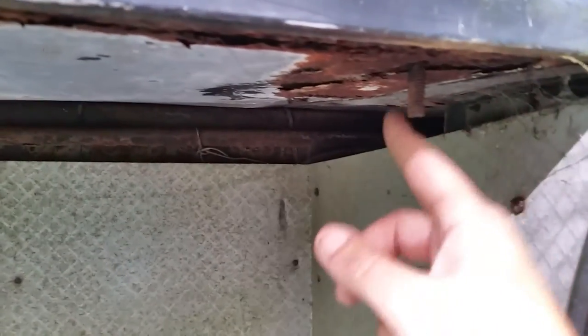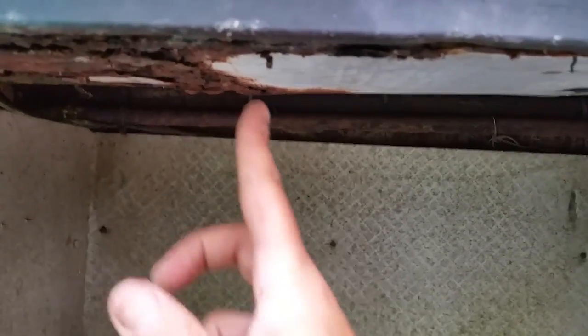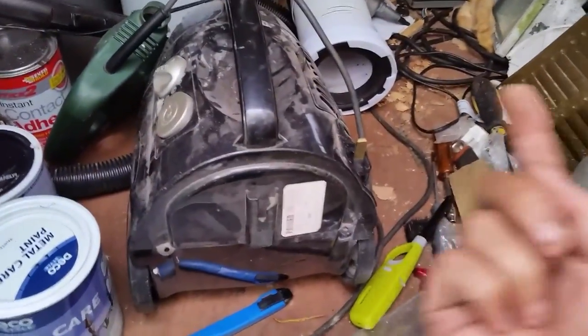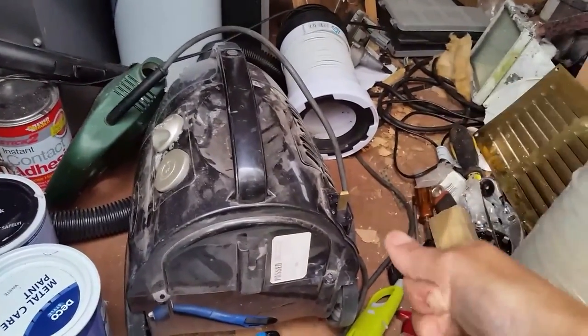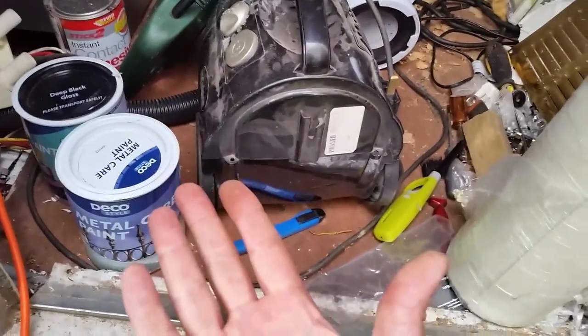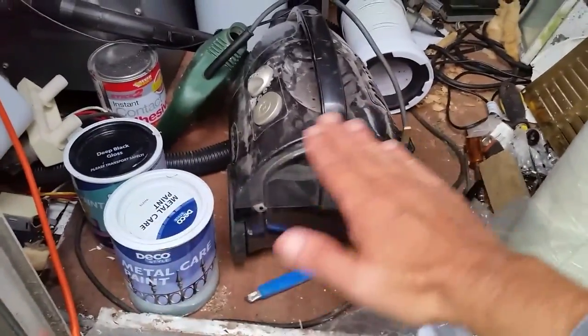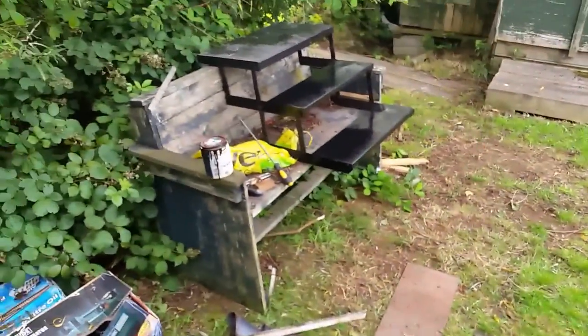So I've got the other three points — there's this one, another one there, another one over here, another one here. I'll need to re-drill those through the floor on those three points, and then cut a slightly larger hole to sink the head of the bolt, which I'll drop down through on those three, and then the steps go on underneath, and then the washers and nuts go on — and that will allow me to still have a flat surface inside. So that's the plan anyway, and I'm really pleased with how it's going.